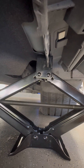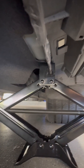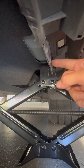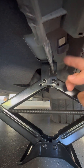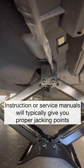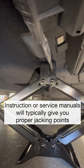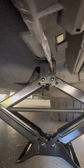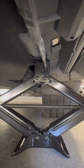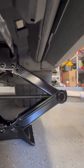You want to jack on the frame. What you're looking for are these ribs that are underneath here, and right above that is part of the frame as well — these are good jacking points. You don't want to jack where there's plastic trim. Also start slow with just a little bit of range to see if anything will bend. If the frame bends, you want to stop and clarify where exactly you're supposed to be jacking the car up.